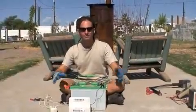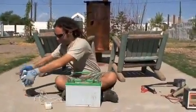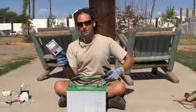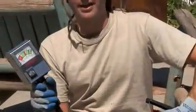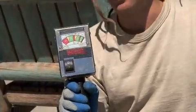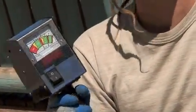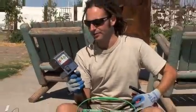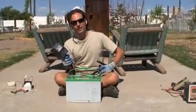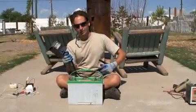One of the most important tools when desulfating a battery is having a load tester. This is a fairly inexpensive load tester — I bought it for $15 new. They go up to $60 and then way up from there for some really high-end digital ones, but you don't need to spend that much. What I like to do is before I start desulfating a battery, see how much load it can handle.